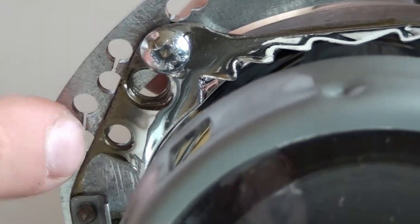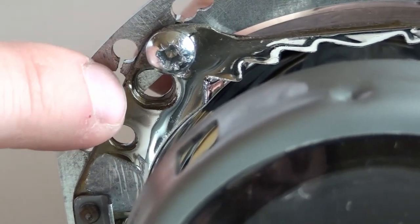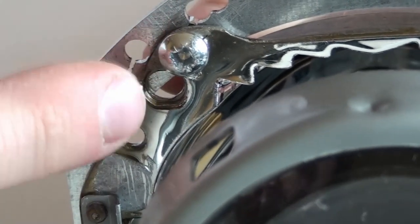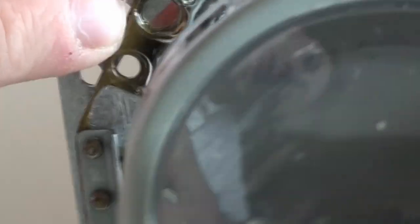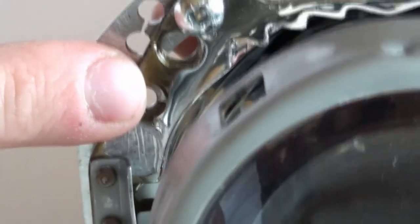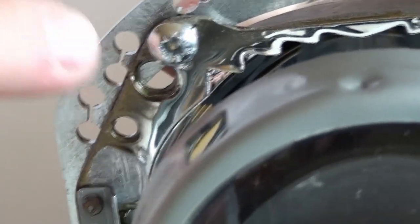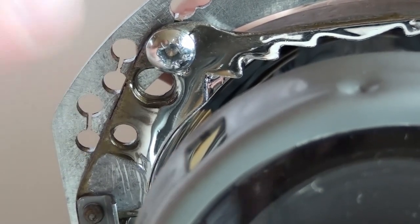this flange on the side of the reflector bowl, and that's why we need to remove some material to clear the path for the molding with the screw hole, and only then we'll be able to attach this projector to our headlight. Even at this stage, it's going to be difficult because, as you can see, the screw hole isn't aligned, it already interferes with the screw.